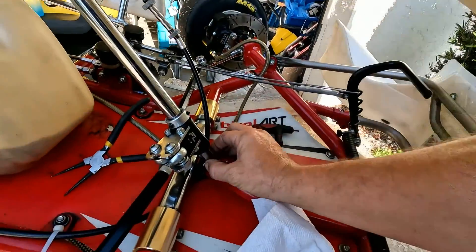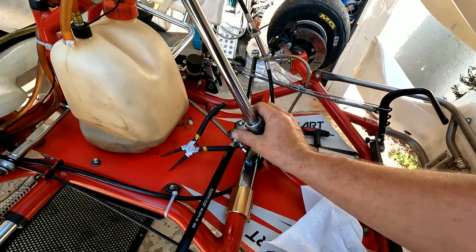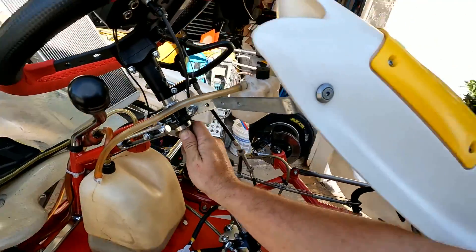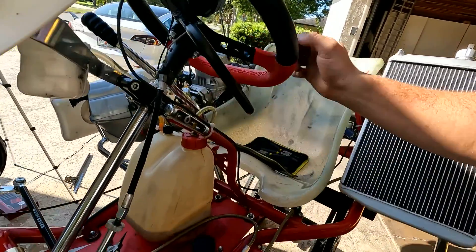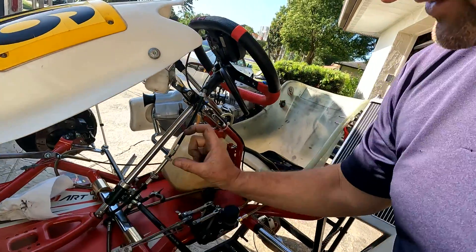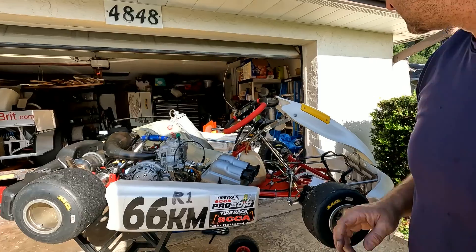The play's gone down — this was obviously so sloppy with the broken piece. Then you have these two little collars that basically hold the steering in place, so as you're driving and putting a lot of force on this, these keep the steering shaft where it's supposed to be. I'm going to make sure these are snug, because if they're not tight enough it's going to allow that to bounce up and down while driving, which I think might be part of my problem. Getting those nice and tight should hopefully help keep everything in check.